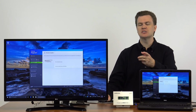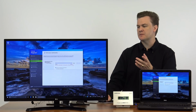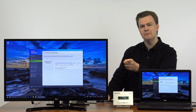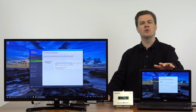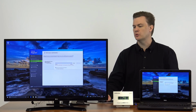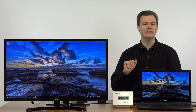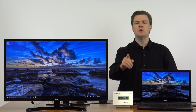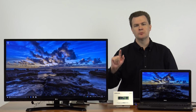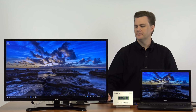All right, there's also some other things you can investigate. There's a performance benchmark you can check out, performance optimization, which is disabled on Windows 8 and higher because Windows 8 and higher has built-in trim support that works better than anything they'll do, so don't worry about it. So we can go ahead and close that. It will run in the background. It'll be just fine. Now, the rest of this will be exactly the same as the previous Windows performance review done on the hard drive.